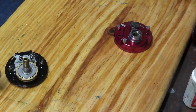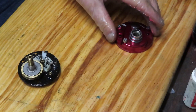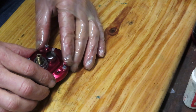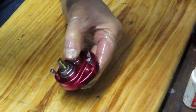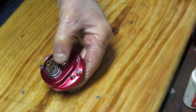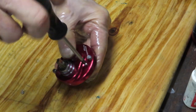I would think that if something is going wrong after having greased this, cleaned it, and done everything with it, there's probably something wrong in the plastic parts and we may have to replace those. Let's go ahead and take the side plate now. I'm going to center that, bring that in, press down so that the springs get compressed, hold the back end and the front, and I'll get those two small screws. For those of you that watch my channel, you know it's probably time to go get a cup of coffee because me and these small screws become adventuresome. This one seems to have cooperated better than most.